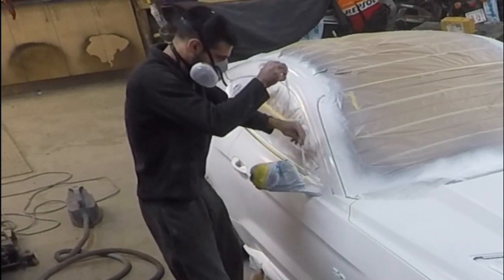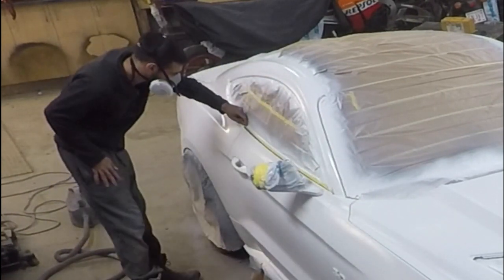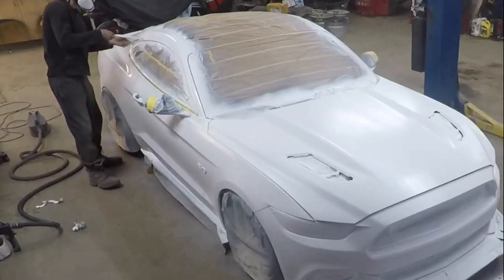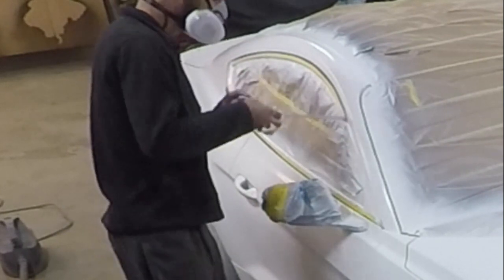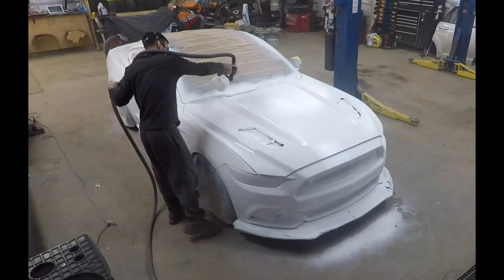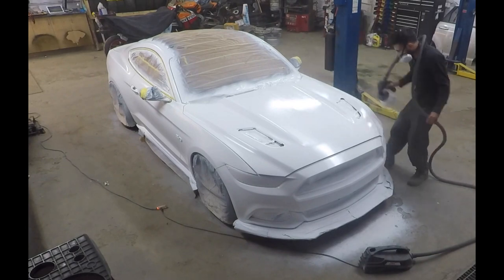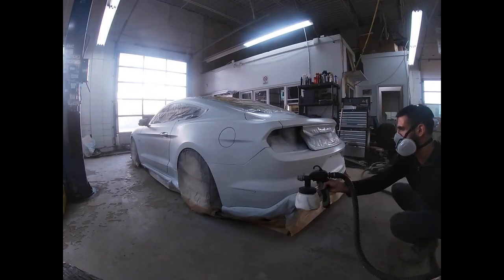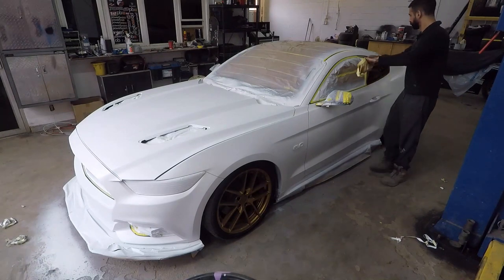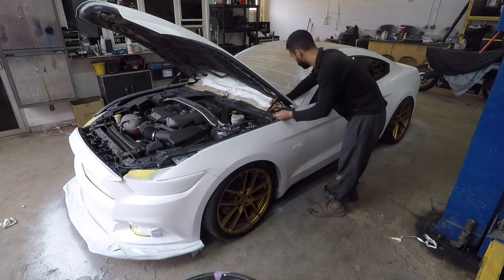Then go over the vehicle the same way you were spraying the white, same way you were spraying the grey. On the last coat, peel any tape that is close to the edge while it's still wet, because if it dries and then you peel the tape it's going to bond with the body and peel the dip off. So make sure you peel while wet — that way you won't have any lifting or issues. For your last couple coats, spray pretty heavy and overlap the coats — I'd say a 75% overlap. Usually I do 50/50 overlap, but if you overlap nicely and spray solid coats and it's all drying in one sheet, then you know you sprayed it well.